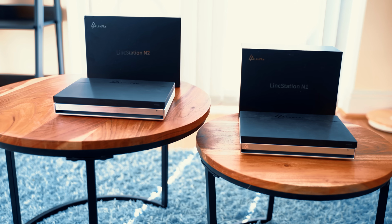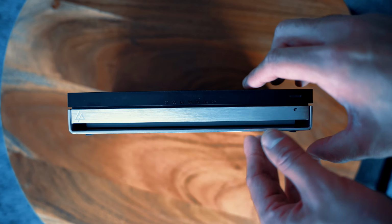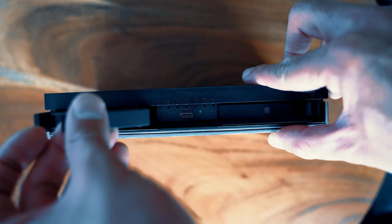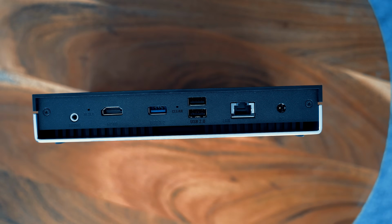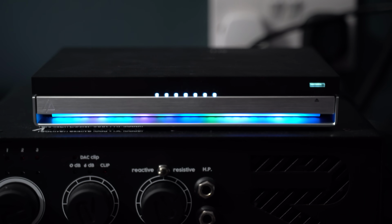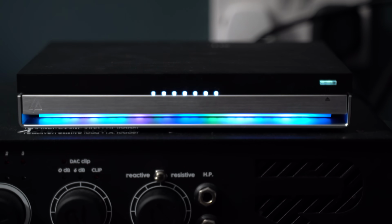Now, my final thoughts about this device. I think that if you're looking for an all SSD NVMe NAS with fast access, with a 10 gigabit network card, a low power CPU, and if you like Unraid, you get 1 year of free Unraid, this is definitely the thing to get. This thing is super quiet. You can leave it in your living room and it won't drive you crazy like mechanical drives do. It consumes very little power. Like I said earlier, it's between 7 and 9 watts. And that's like SBC, single board computer territory right there, that type of wattage.